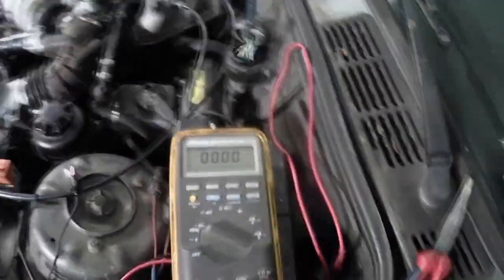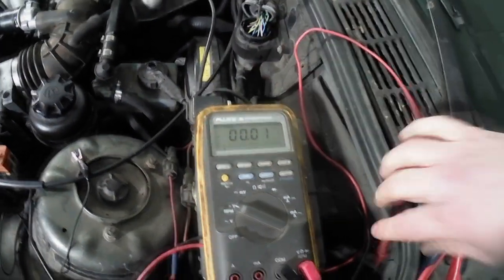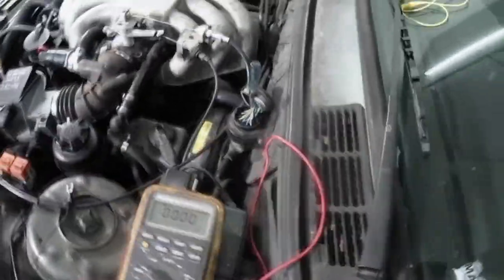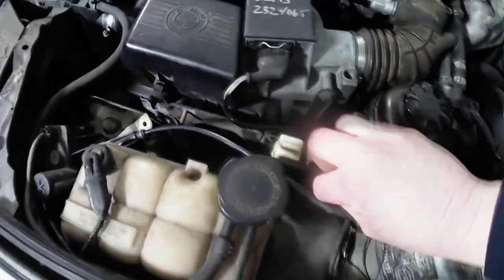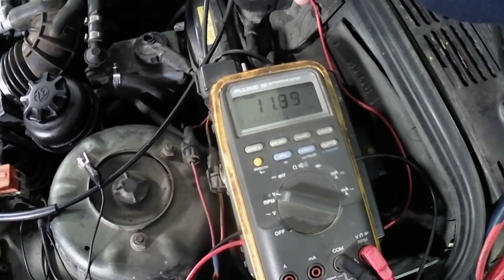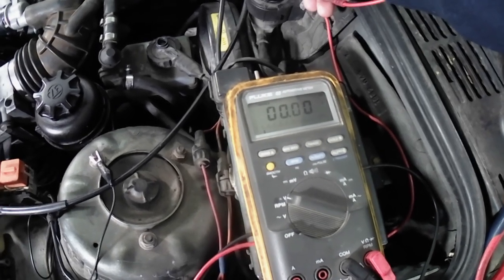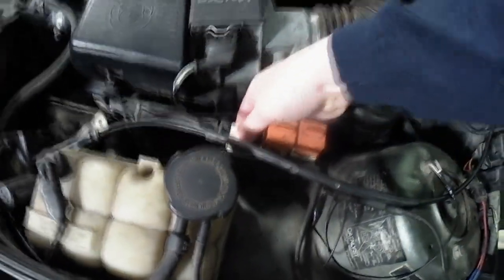If I turn the car off, nothing. Car back on, 12 volts. If we unplug this relay, we still have 12 volts there, because what it's doing is the key is sending power through here, through this, back to the engine harness, and then it's sending it to this relay, which then turns the computer on. Okay, so